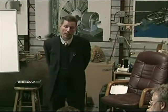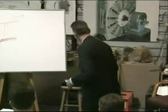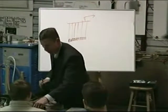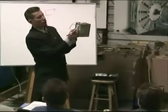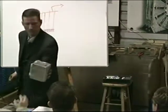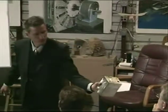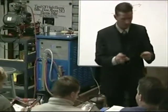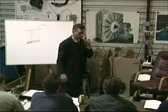So the water level won't affect the foaming? Well, yeah, I mean, you're going to get foaming inside, and you know what? Since you're passing these around, let me make one little mark on here. This is the water level. Since you guys already looked at that, look, we're about a half inch below the nipple. Any higher than that, almost guaranteed it'll foam.